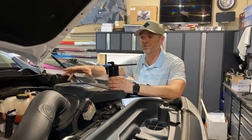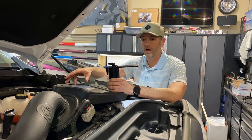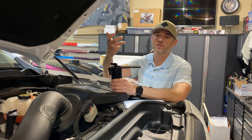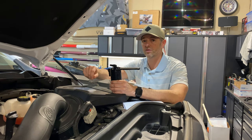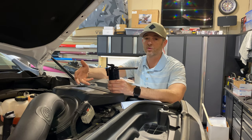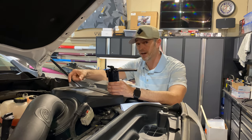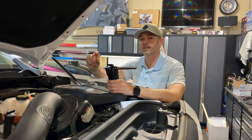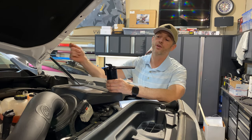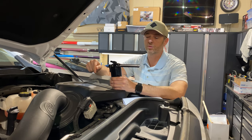When your engine's running it starts to build up pressure. That pressure needs to go somewhere — it's also known as blow-by. With the internal components having that pressure build up, it accumulates particles with it: whether that be unburnt fuel, oil, or possible contaminants, it needs to go somewhere. So your positive crankcase ventilation, or PCV valve, is responsible for taking that extra pressure with all those extra things in it, returning it back into the intake side of the combustion chamber, allowing it to be burnt off again.